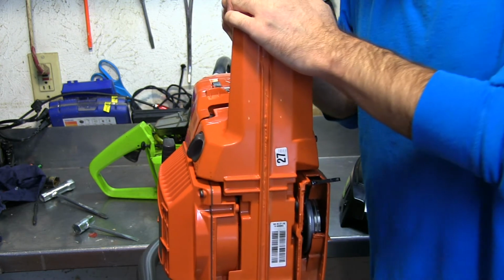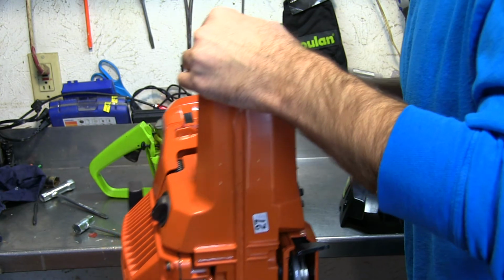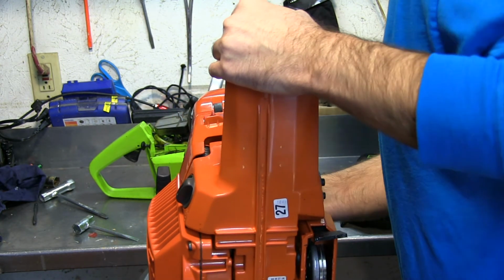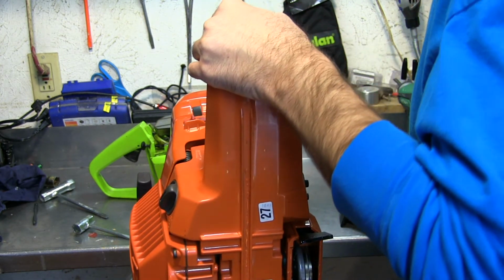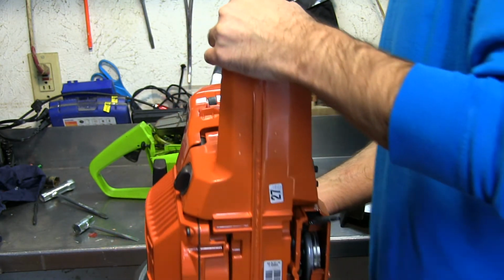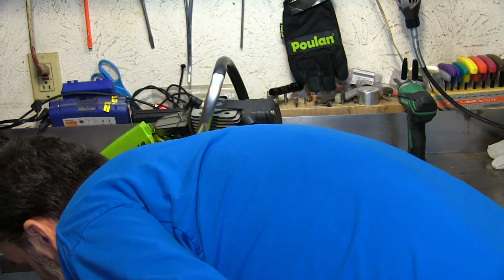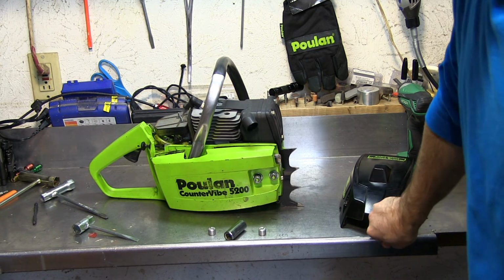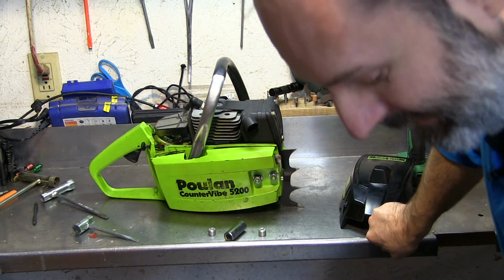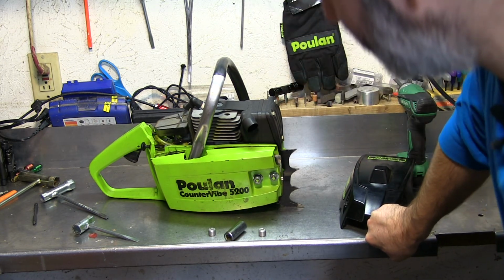I didn't do machine work on it. Don't have the ability to do that right now. I don't have a lathe at my disposal. But I did remove the base gasket. Compression's still up near 200 psi, so I think that's just fine. And with the numbers I put on it, I advanced the timing a bit. That thing sounds good. It's going to scream.